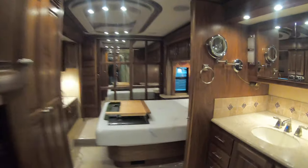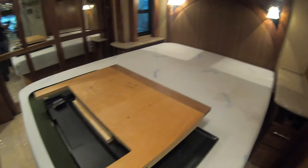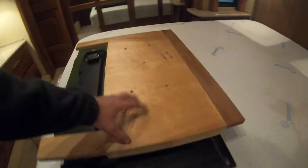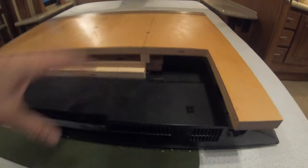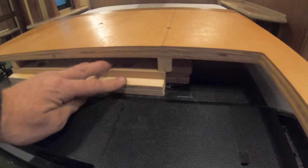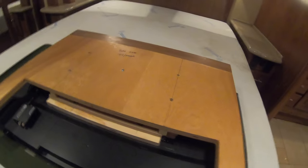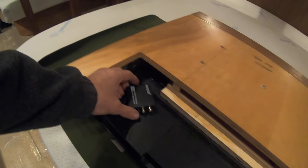In the rear location it's going to be really similar. In a simple way: measure the TV, come up with the closest size that would fit in the hole, take the stock backer off the stock TV after you pull it out. In 2005 and 2006 there are only some screws across the very top — they go across above the TV, so you've got to use a long extension to get those in. Pull the TV out, take that plate off, measure your new distance difference, make your new plate, install it, then screw this to the plate and that'll go right in there.